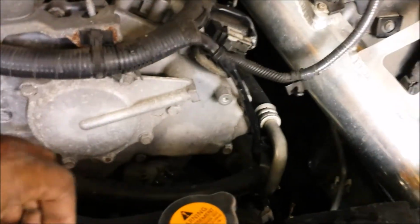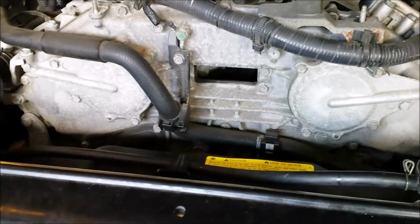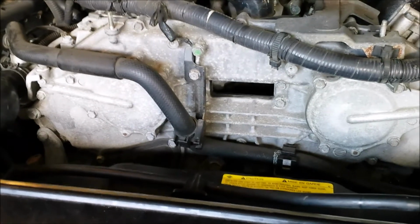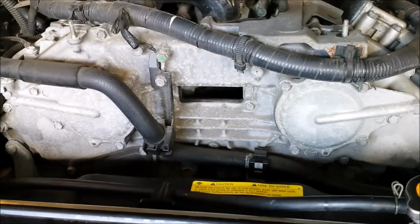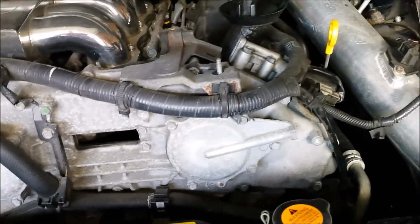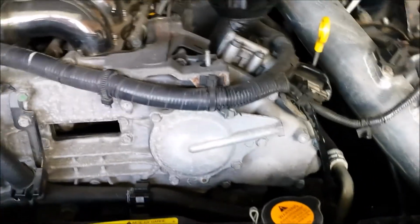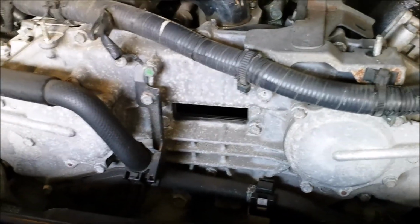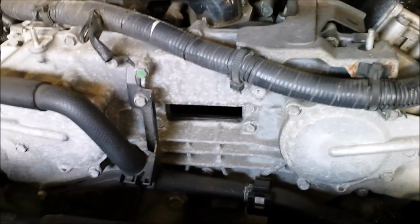And then what I did, let the temperature on the car get up to around, let's say, at least 180 degrees Fahrenheit. Then I gave it a few revs, like between 3,000 to 3,600 RPMs for about 15 seconds, and that will bleed out the air bubbles. So looks like the heater is hot enough. I'm about to clean up in this garage, and I'm about to do some data logs to see how this car will perform with the new radiator.